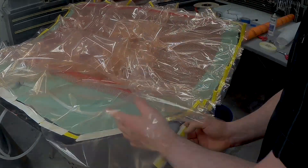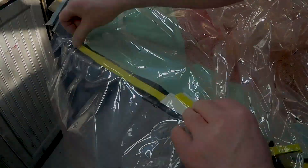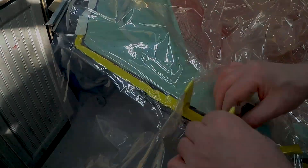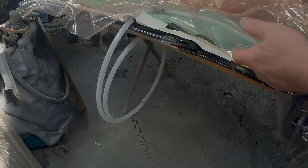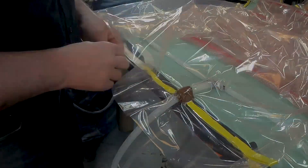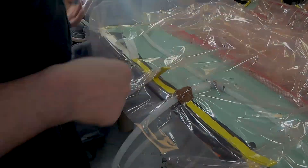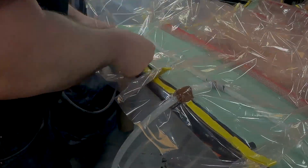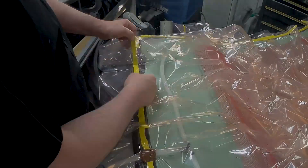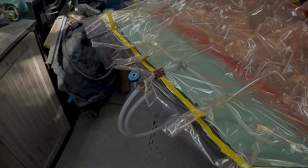The insertion of pleats is also how you control pressure. Here I'm showing you how to close the pleat off. We've got the area matched and it's always that last pleat — I'm just testing the bag as I go along, checking how much slack I have. We're working our way over the feed lines there. As I make my way into the last pleat, I do it in the other direction — I change the direction of the pleat — so that I can lay the bag back on itself and be sure that I get it to close nicely.